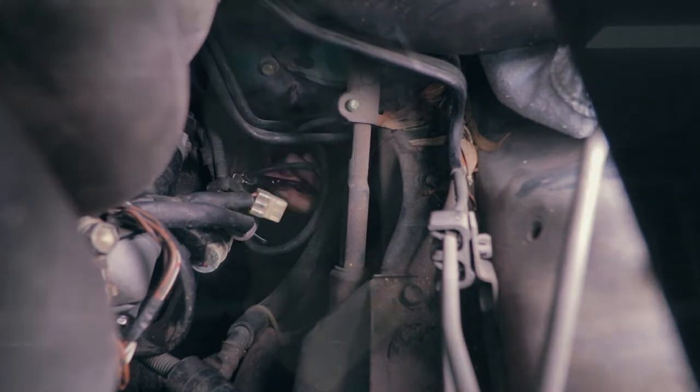Pump down. And then once you start feeling the pedal come up on its own while the line is closed, you'll know that the air is mostly out of the system. Just do it a couple more times and close it up, top it off, and you're all good to go.